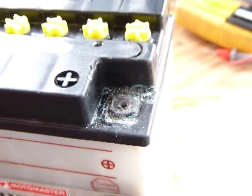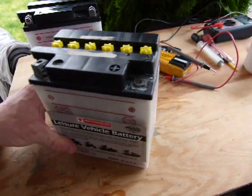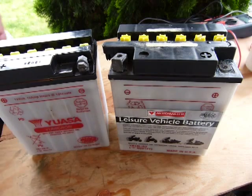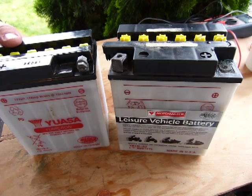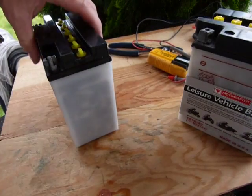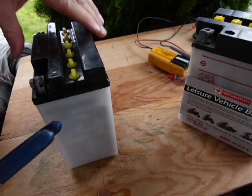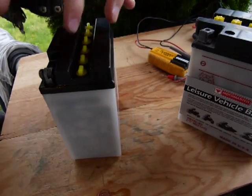So that covers the physical appearance of the battery, maintenance-free or not. The terminals should work, the case should work, and the level of electrolyte should be within the manufacturer's minimum and maximum marks. On a maintenance-free battery you don't have to fill the electrolyte, but on a non-maintenance-free battery you will need to. If your electrolyte level doesn't check out, you're going to have to fill some in.